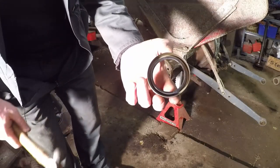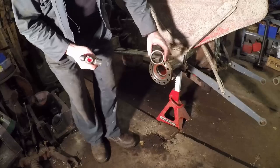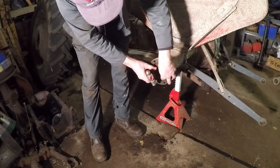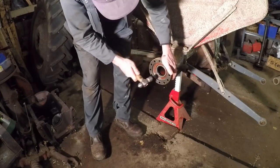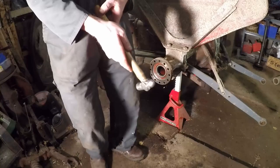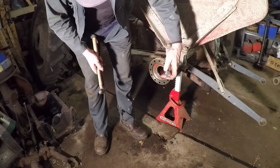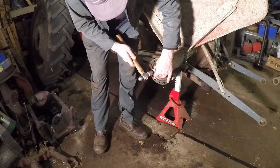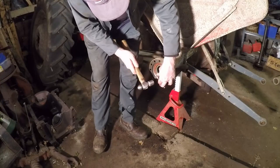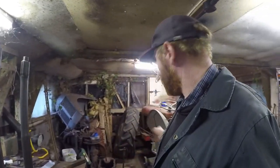We'll give everything a wipe out. This was the one that was leaking badly, all down the brake back plate. So this is our new seal — spring side always goes towards the oil, so he's going to go in that way. Just tapping on the metal casing; don't damage the rubber. We'll use our little press tool again. There we go. Both new bushes in, both new seals in — now we're getting ready for the big assemble.